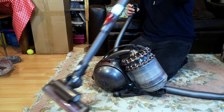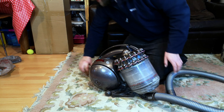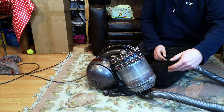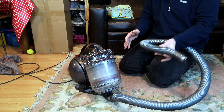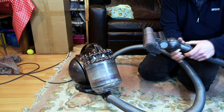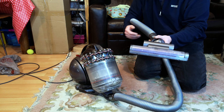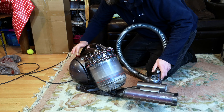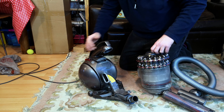This landed literally 10 minutes ago — I haven't done a thing to it beyond what we've just done. Let's start troubleshooting. The suction — actually, it's not awful, I can't lie, but it's not sharp either. It's got airflow but it's not great. These things roll along quite happily when they're in decent fettle; this one definitely isn't. Let's check the brush roll — it shouldn't spin that slowly. That is greatly reduced performance somewhere.